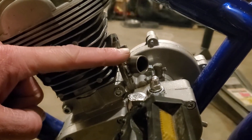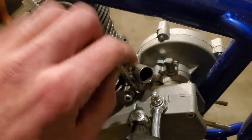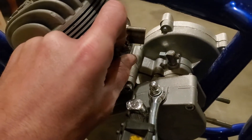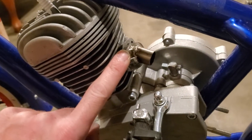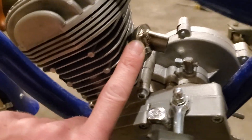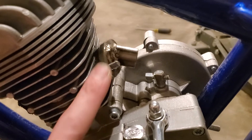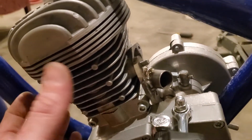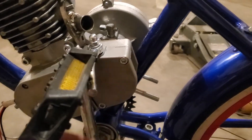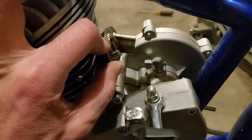You can actually use those, but this is the bigger intake spacing so that wouldn't work for me — the one I had was for a smaller intake, so I had to make my own. But if you get a short intake, that downward angle is kind of ideal when you're doing a smaller build like this, because you can't really have the engine cocked way forward — messes with where the chain sits and all kinds of other stuff.